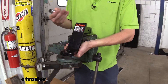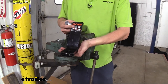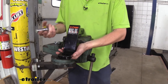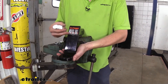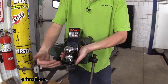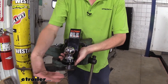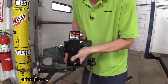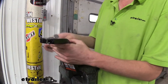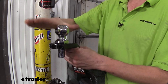The first thing you're going to want to do with your draw bar when you get it is determine how you're going to be using this. Are you going to use this with a truck, maybe one that's got potentially lifted suspension? Or are you going to be using this with a smaller car, something that sits pretty low to the ground? That's going to determine how you install your ball. If you install your ball in the drop position, it lowers the ball down from your hitch so that way you can achieve a nice level pull on your trailer. And if you're in a smaller vehicle — we've got a Honda Civic that we're working on today — we want to put it in the rise position. Since it sits so low to the ground, we need to raise our ball up so our trailer can ride level.